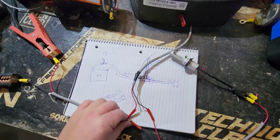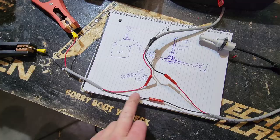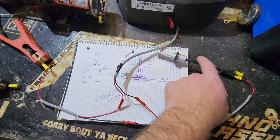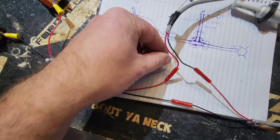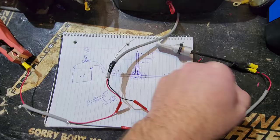When you get to that main junction, you have your battery cable running to where you want it, and wherever you decide to enter your cab, that's when you start doing your joints. Your negative always goes to your device. You have two wires coming off the device to that main junction as well, and then your wire going into your cab through your firewall. Then your 12 volts goes in to your switch and 12 volts comes back out to your light.